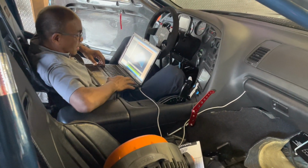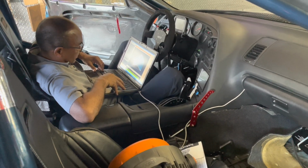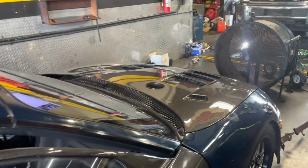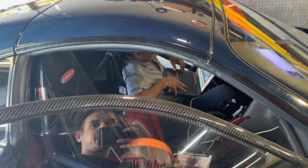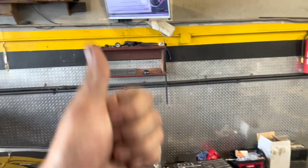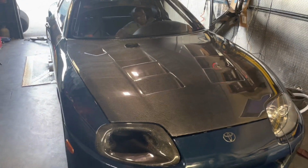So yeah, he's got 12 injectors firing perfect. He's got the 7-bar map sensor now in the car going perfect. He's got a fresh tune-up for everything that I changed: the intake manifold, header, turbo, changed a lot of stuff. And we got her dialed in. Time to get to the track and let it eat. Start cranking the power up and up and up. And now we have a good baseline. So that's close to 1,400 horsepower without breaking a sweat.